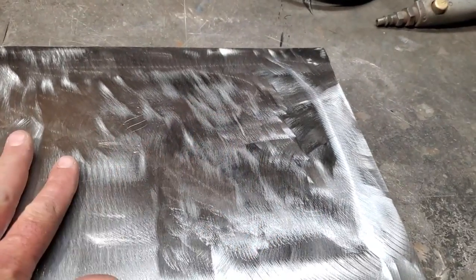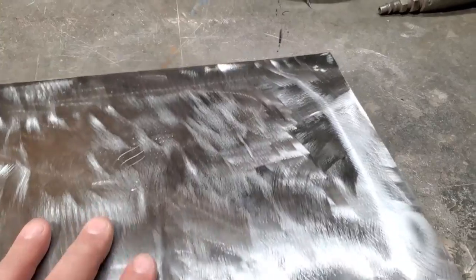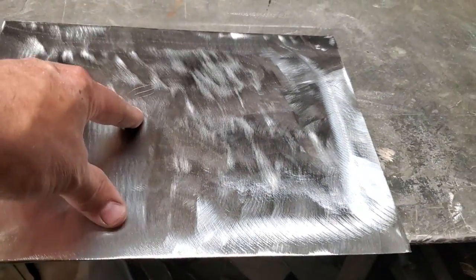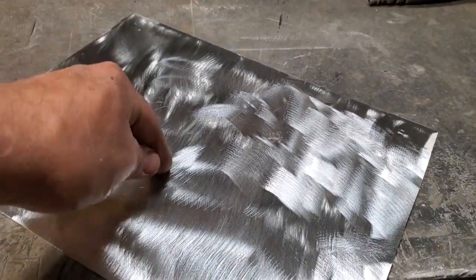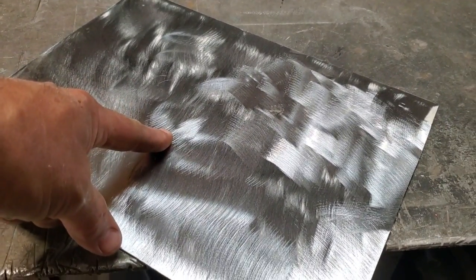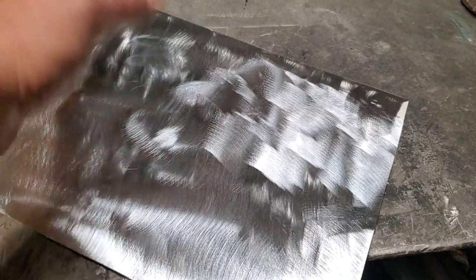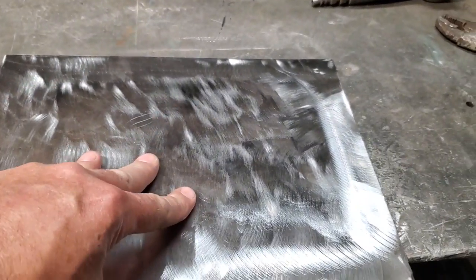That way you'll have all the sanding process completed, so when it comes time to apply paint to it, it will stick. One problem I've seen many people do is they'll have a brand new piece of steel, they'll cut out their piece of steel, they'll turn around, they weld it in the car, and then when they get underneath the bottom of the car, this section of the car is not even sanded. So you end up just painting over the top of it. When you paint over the top of it, all the paint will peel off because there's an oily residue on it or whatnot. But if you sand it now, the paint will stick to it when it comes time to add paint to it.